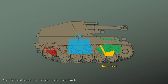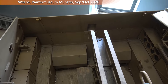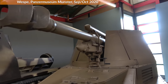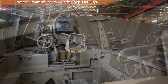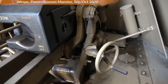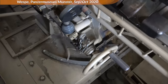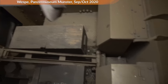If we look at the Wespe layout from the side, we see that the engine is located below the gun and behind the driver. At the very back and below the fighting compartment the fuel tank was located. We are now in the fighting compartment. As you can see the 105mm howitzer takes up most of the fighting compartment. This was the regular field howitzer of the German Army in World War II. This particular version is the 10.5cm Leichte Feldhaubitze 18M — where the M stands for Mündungsbremse. On the right side we have a wheel for the elevation of the gun, which ranged from minus 5 degrees to 42 degrees, although a British report from January 1945 notes minus 6 to 37 degrees. On the left side we have a wheel for controlling the horizontal traverse of the gun, which has 17 degrees to each side.